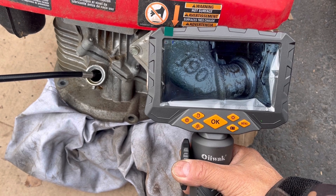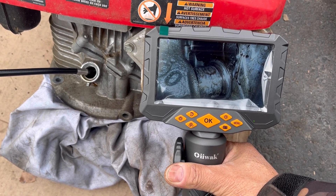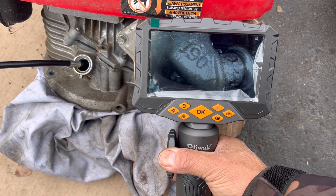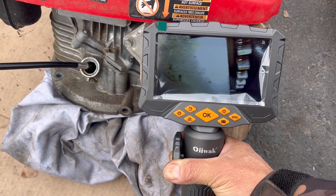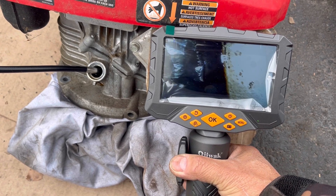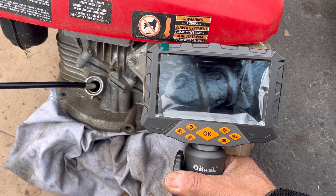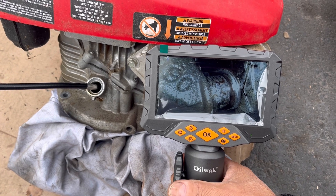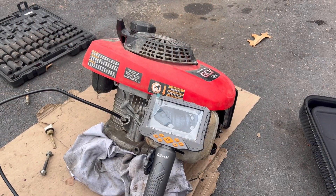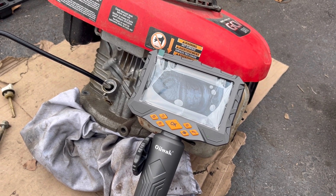You can clearly see it says '190' on the crank. There's the crank journal - I'm going to turn this just a little bit. That's the crank journal right there. There's no connecting rod attached to it. It's in a very bad condition - worn connecting rod journal, the bearing is gone. I don't think I can turn it anymore without it hitting something. So this GCV 190 pressure washer engine has a blown connecting rod, which is why we have no compression. Other than that, you could use it all for parts.